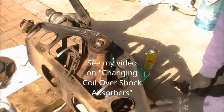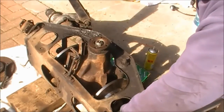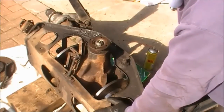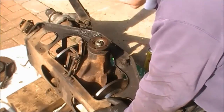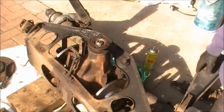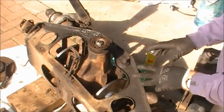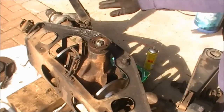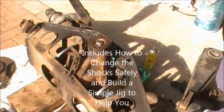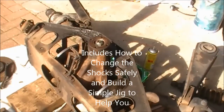Once you've got the caliper in, you're going to have to replace the handbrake mechanism on the top. Make sure that's all running true and then try it before you tighten it all back up — make sure that everything has no dirt behind it and it's running nice and true. So there we are, that's how to do the brakes and calipers. It was one hour and five minutes to disassemble one side, so that's two hours and ten minutes on the two. The first one took me a lot longer because I didn't know what I was doing and there were no instructions on the internet. I hope that helps you. My name is David Pengelly, thanks for watching.